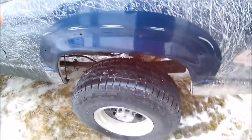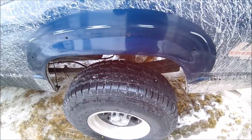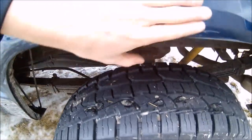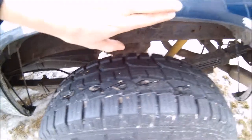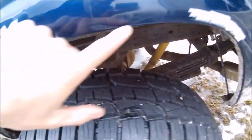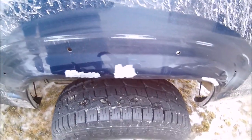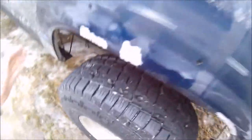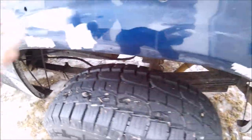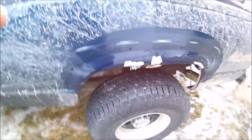We're back — I got the spots ground down that needed to be ground, as you can see. This one here I gotta do a little bit more on, and there are a few spots right in here, so I'm probably just gonna touch it up a little bit. Then I'm gonna take paint thinner or degreaser, wipe it, scuff the area I'm gonna be painting around, and then take this rust reformer and spray it on there.